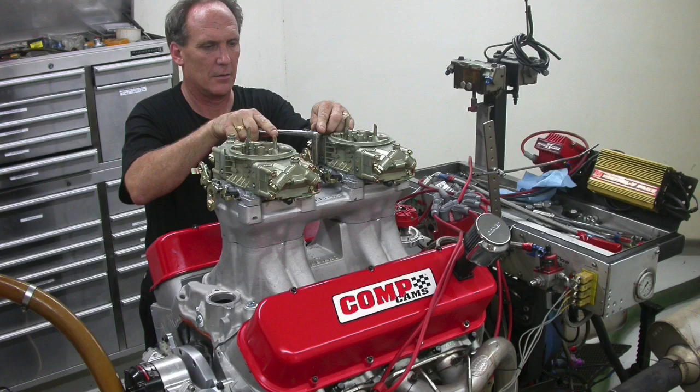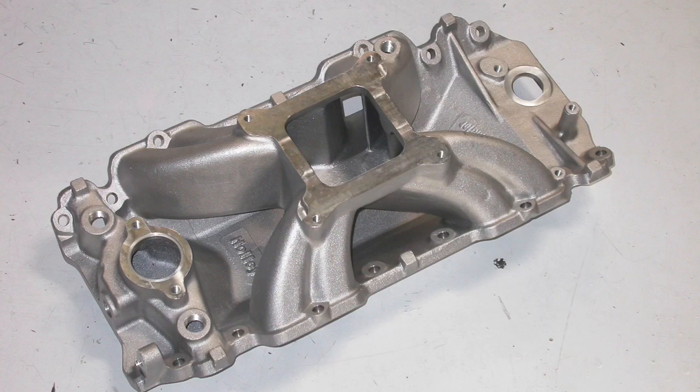Let's get to our conclusion. What did we learn from the intake test on our 496 big block Chevy? When it comes to power production, nothing beats a tunnel ram — not the single plane, not the dual plane. The dual plane makes more power down low, the single plane makes more power up top, but the tunnel ram makes a lot more than both: more peak power and more peak torque. Down at lower RPM ranges, it was actually better than the single plane. So the question is not about power — it's about fitment. If you're putting it in a Chevelle, Camaro, or truck, do you want that thing sticking out of the hood? I say yes. For a boat, as long as it's not a family boat with an enclosed motor, you definitely need a tunnel ram. The only thing better than a tunnel ram is a supercharger. Thanks for watching — like, share, subscribe, ring the bell.